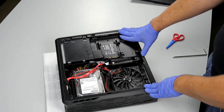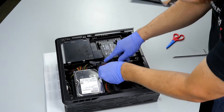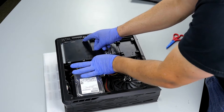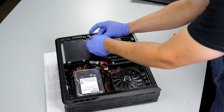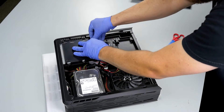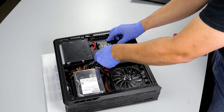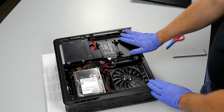This is pretty much in — that was the hard part. Now it's just a matter of reconnecting everything. The first thing is to take the cable for the optical drive and snake it through the little channel under here. You just have to put your finger in this little area and guide it up, because sometimes it will try to go underneath this bracket, which can be frustrating. Get the small port on this side, get the cable in — okay, that is connected and taken care of. Now we'll do our solid state drive. That is connected. The only thing we really need to do now is secure this in with the six screws that we used when we removed this. The thinner screws are the only two that are different, and they go on the back.